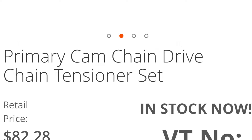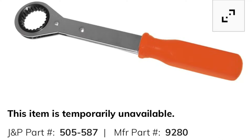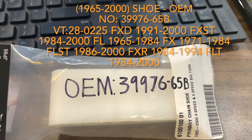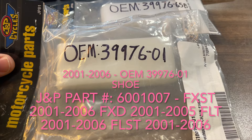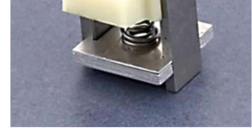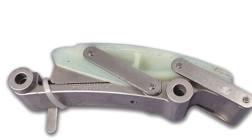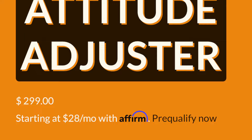While you've already opened the primary to get the camshaft timing correct, the K-Star crank wrench for 07 to 17 comes in handy for turning the motor over. You might as well replace the primary chain tensioner — OEM reference 39976-65B for 1965 through 2000, and 39976-01 for 2001 to 2006. If you have more horsepower or your shoe cracked — which is very common on the 01-to-06 — you may want to run an upgraded Hayden tensioner M6BT01. If you had no luck with the auto tensioner, you may want to try the Hayden or Screaming Eagle manual one, though neither is popular for excessive noise and component wear.